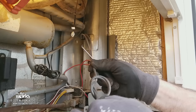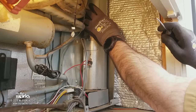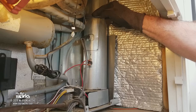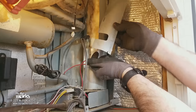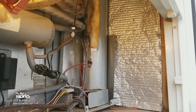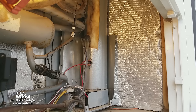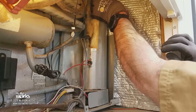So now we've determined that our heating element is bad and we need to access it. This particular refrigerator has a boiler with a long slot right here. We're going to remove this slot cover, and you're going to find this little metal tab right there. You're going to pull that back — I'm using the same little hooky tool — and pump that off. Then this whole thing raises up and comes out just like that. Here's that little tab, and here's the slot it was in — slot at the top, slot at the bottom. And what that leaves us is the heating element in a little groove in the insulation, and we're going to pull this thing straight up.